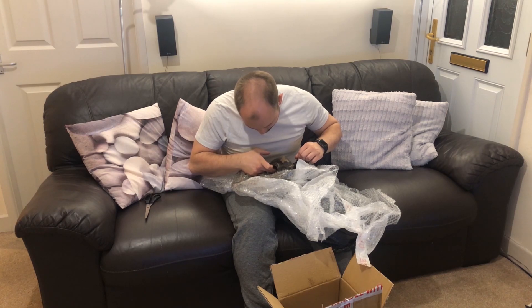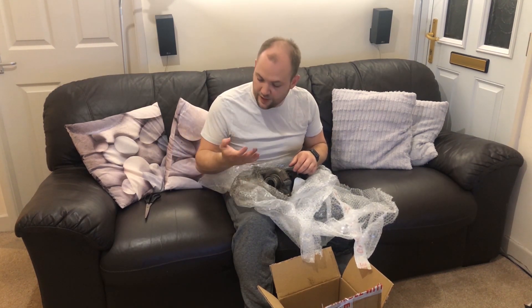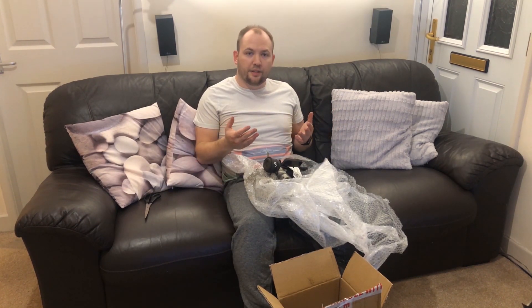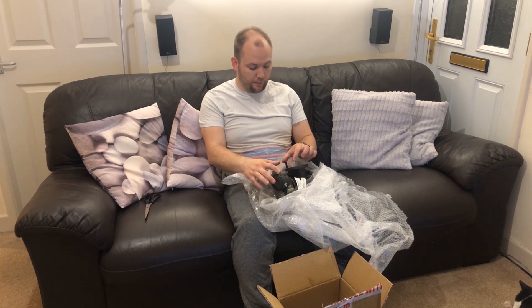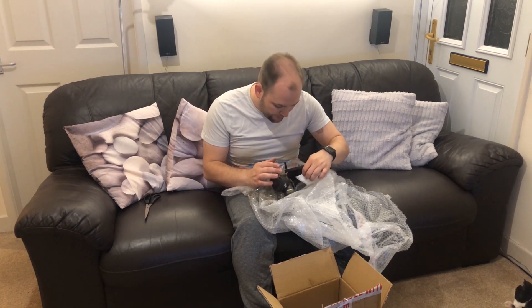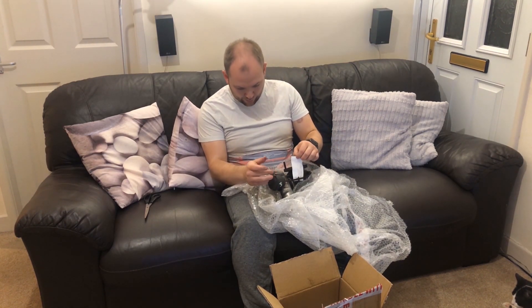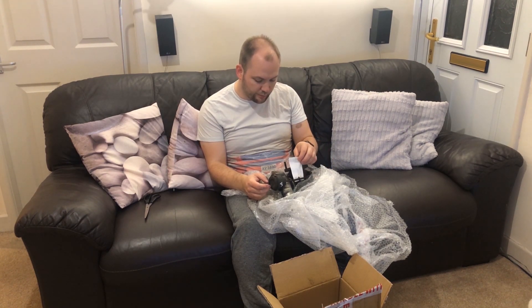Fantastic news - no movement, no play or anything like that. I'll get a close-up video later on and we'll compare it to the original. Overall fantastic news. I believe when they decided to change the turbo, they used different coolant lines, so I need to look at what we've got compared to what we need. I want to take the studs off the original exhaust manifold. So apart from that, it seems good news. I've been looking at the 3-inch downpipe and I think I'm going to get a friend to make one. I've noticed that the actuator is slightly bent here - I'll see how that's going to affect it. It seems okay at the moment but I will check it and see if I can free it up or straighten it.